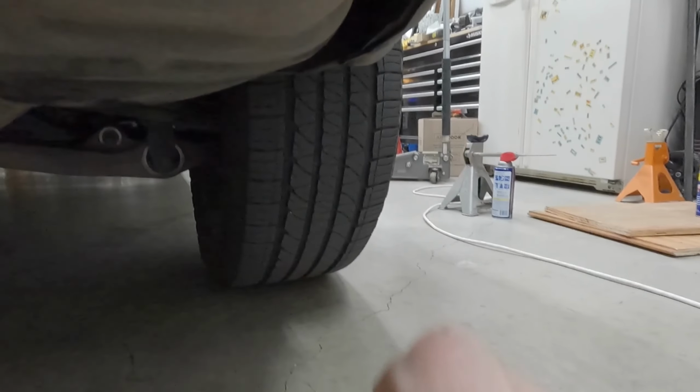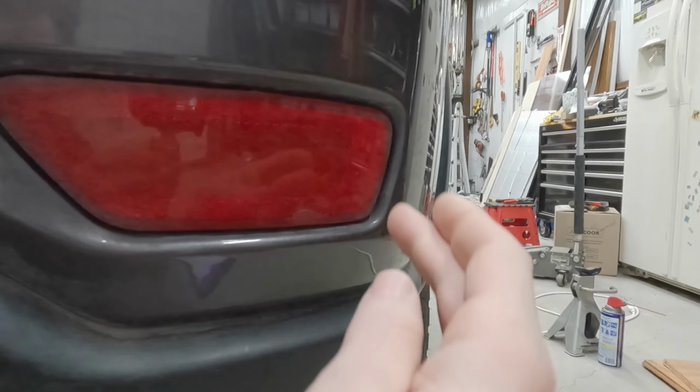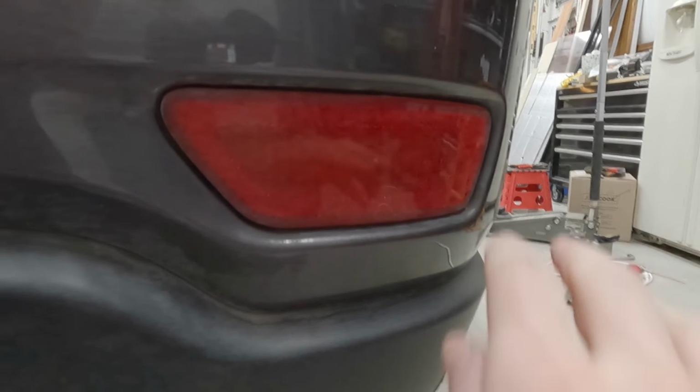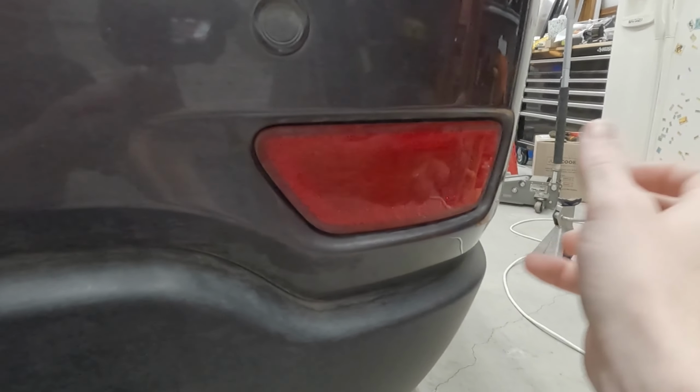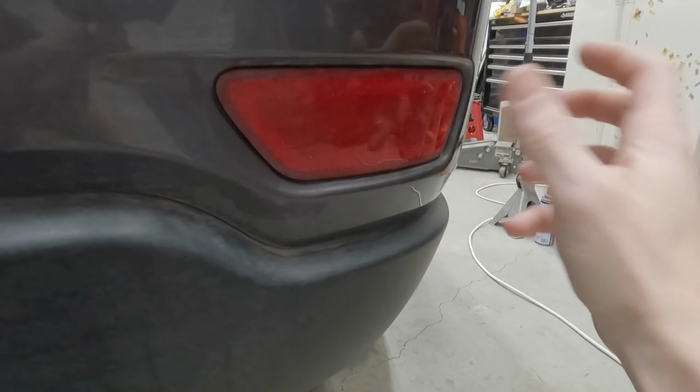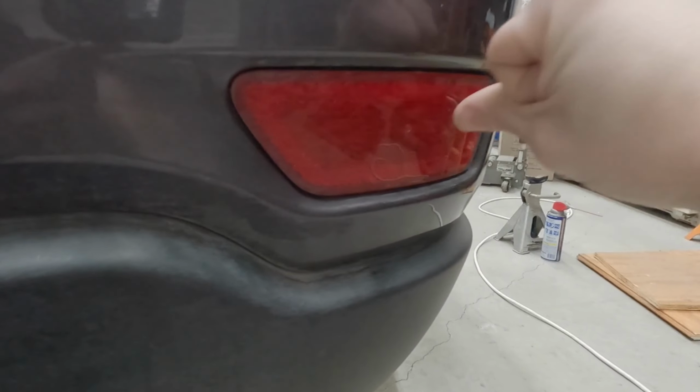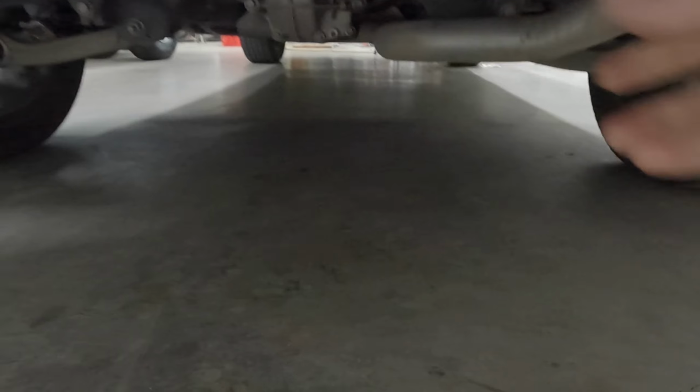Now, I did that, and then I was like, okay, I'm solid. But then there's actually another hanger that you can't see up here. It kind of sucks to get to. I scratched my hand a little bit getting in and out of there. You can pull this thing off. Just get a screwdriver, stick it here, and pop it right off. That's an easier way to get in with your hand. Again, spray it with WD-40, reach in there, give it a nice firm tug and wiggle a little bit, and you'll get it to come off. Then slide that whole exhaust pipe out the back.